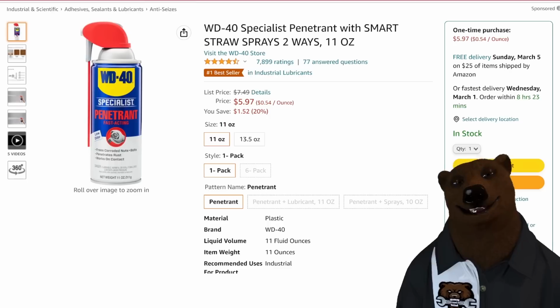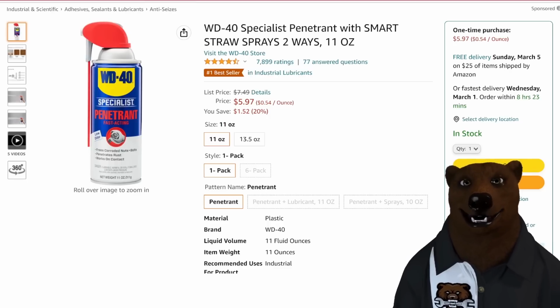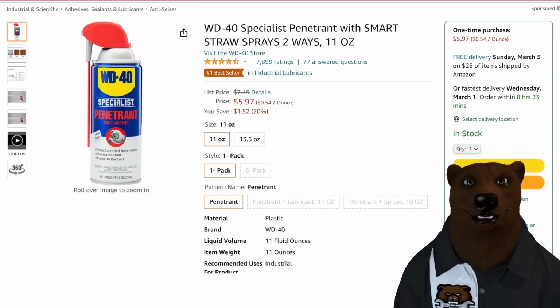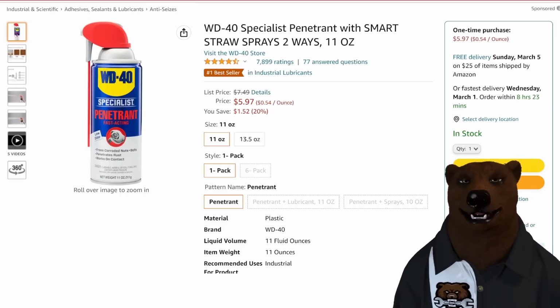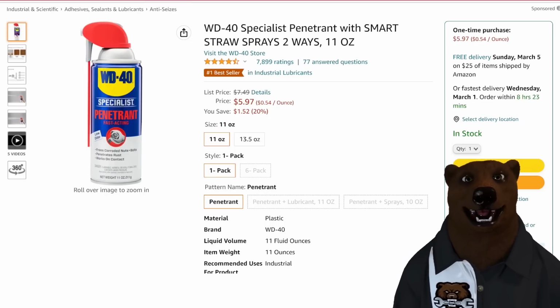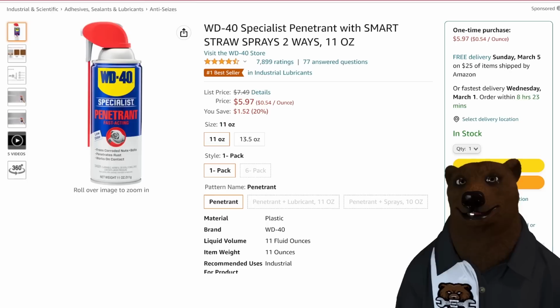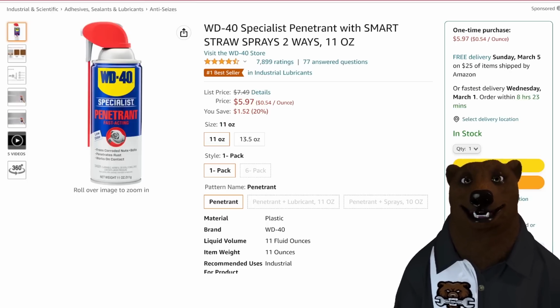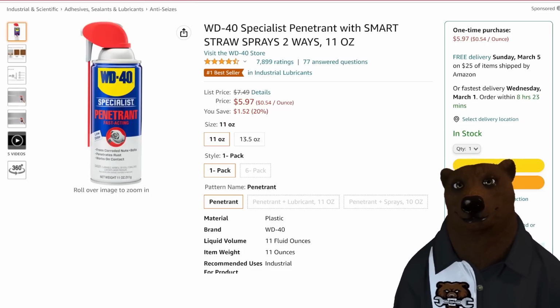Anyway, the fact of the matter is that really affects the hinges in my truck, and I'm constantly getting squeaks in there. So here's what I do. I take WD-40 and I just douse the hinges in WD-40. Then I come in with some compressed air about an hour later, and I blow them out, all right? And then I leave it for a couple days and let that WD-40 dry out. Then I go in with white lithium grease, all right?